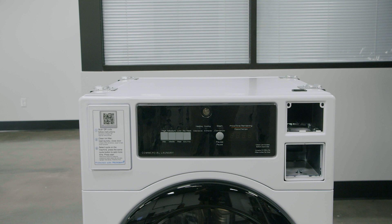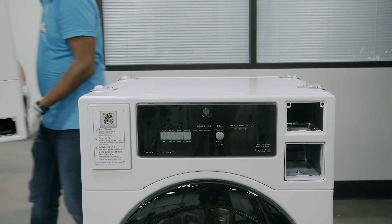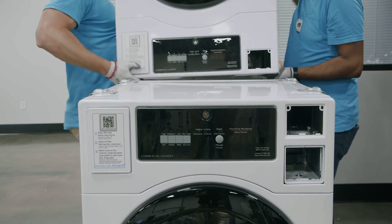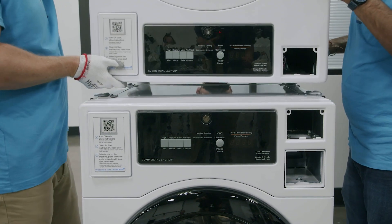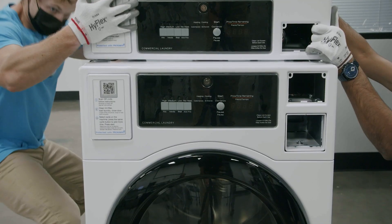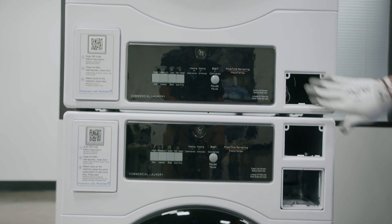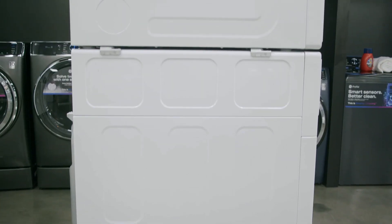Step 4. Lastly, we are going to stack the two dryers together. Two to three people will be needed to safely lift and position the top dryer onto the bottom dryer. Carefully lift the top dryer and move it from rear to front, ensuring the four flange head screws on the bottom of the top dryer are slid into the slots of the stacking brackets on the top of the bottom dryer. In the final position, the front panels for the units should be flush and aligned in all directions.